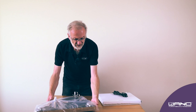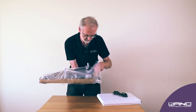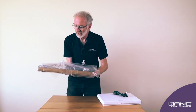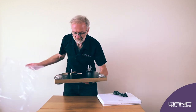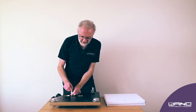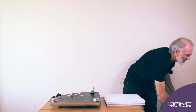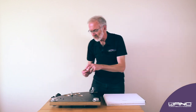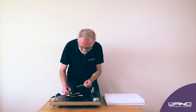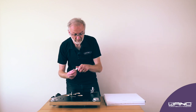The first thing to do is slide off the plastic from the main turntable assembly — it's just taped on the left-hand side, and then the bag slides off. Take the cover off the spindle. It already has some oil in it, but it's good to add just a few drops — one drop down the side and one or two drops in there. The oil comes with the turntable.